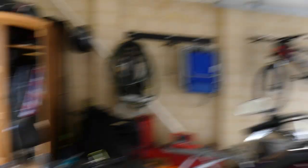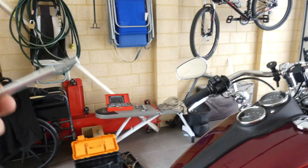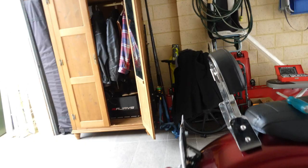What I've done is I've disconnected the shocks so that the back wheel drops down and you can get down underneath and get to the bolts that are up in here. Easy to get those bolts out — already taken one bolt out, this one's come out, and I'm going to get the other one out. Need to disconnect these turn signal wires.